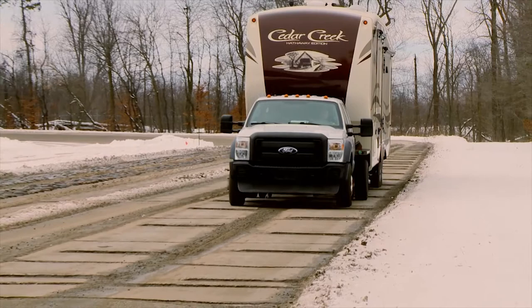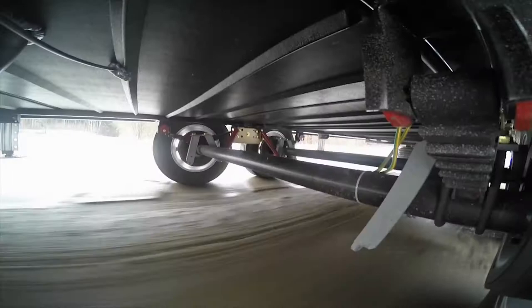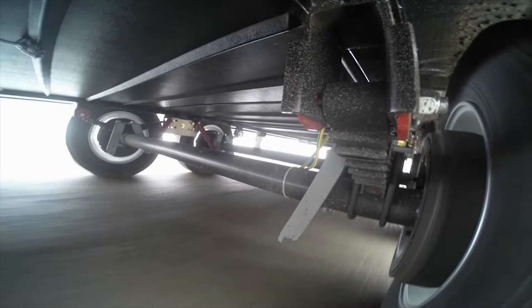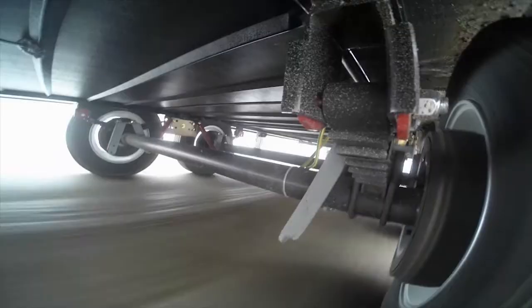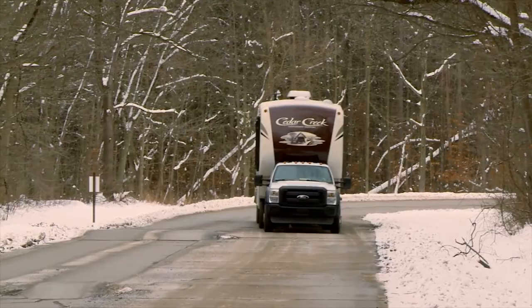The All-American Super Suspension's energy reduction performance was measured and documented during the Navistar Proving Ground Brutal Accelerated Durability Test. The Navistar Proving Grounds have durability roads containing a variety of surfaces designed to push the limits of vehicle structural integrity. These surfaces increase the frequency of conditions typically found on public roads for the purpose of accelerated mileage accumulation, allowing a test of only 1,000 miles to represent the total mileage a vehicle would experience in its lifetime. The energy transferred into the test RV structure was measured and compared with a similar RV with a conventional suspension over Navistar's durability road surfaces. Energy transmitted into the unit with the All-American Super Suspension was reduced by an average of 82%.